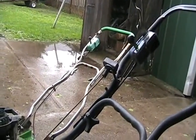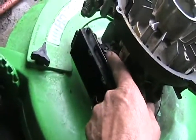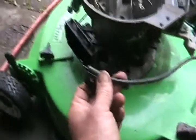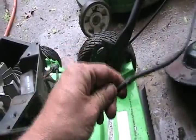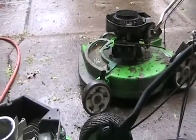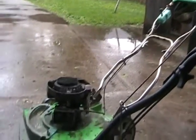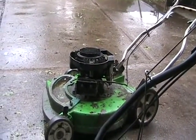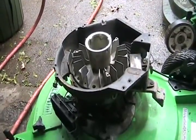I just went to move the lever up and down for throttle and choke, and the choke did not move — but it does work if I push it manually. I checked the cable and it's got a broken spot. Luckily I have a parts mower nearby and the cable from that is good, so I'm going to switch it — that's probably all that was wrong with it, why the guy got rid of it. No choke, no start, no prime either.